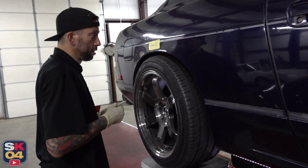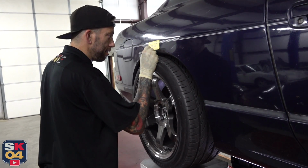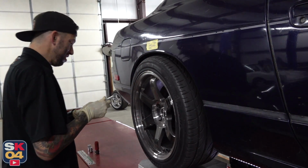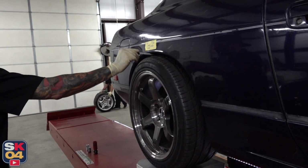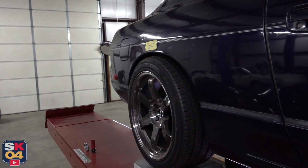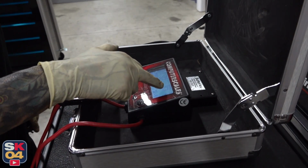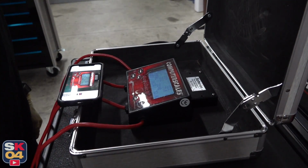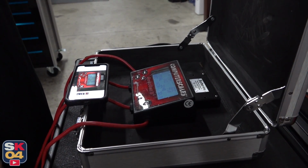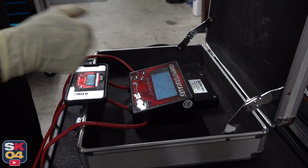That's there. That's it. We finally made it to our 24 7/8. Cool. Now we have gap. Let's see where everything else moved. So it added about 30 pounds to the back and about 20 to the front. By diving it to the front. Yeah. And it went from 53.6 to 52.0.